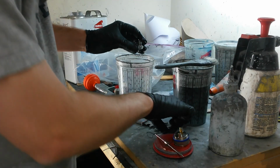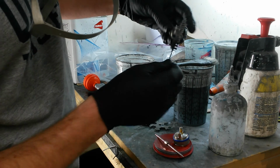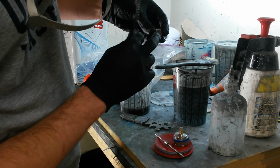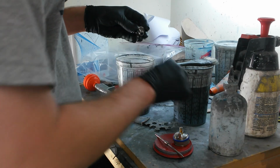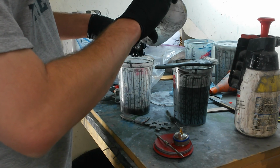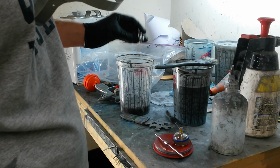This is the fluid tip. And be very careful. You don't want to run this metal end of this down in there and wear it out. I'm just kind of staying back to the back where the paint is. In this gun there's a plastic insert which seals this to the gun. I'm mainly just cleaning that out. If you do this every time you use the gun, you really don't have to scrub it. You just rinse it as long as you don't let anything dry in it. Do this immediately after you get done spraying.